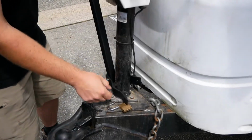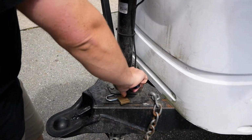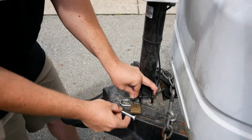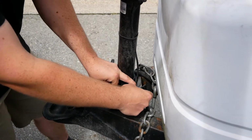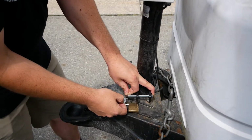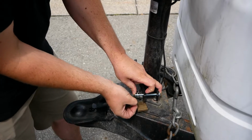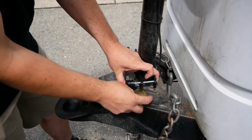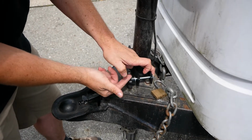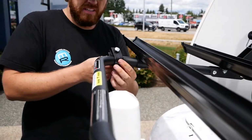If you have chosen a model of the Arvika bike rack that handles either 3 bikes or more, or you're planning on putting e-bikes on the bike rack, you will also have a recommended brace. Strongly recommended. If you have an analog jack, manual jack, that'll be a single brace. If you have an electric jack, because the motor's on the top and it can't go straight up, you will end up with 2 braces going left and right of the lower hoop, holding the bike weight.